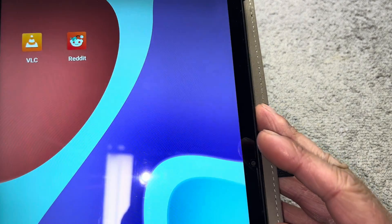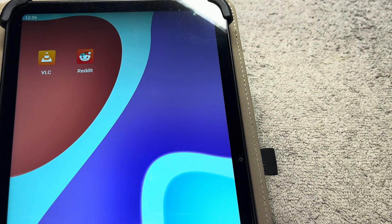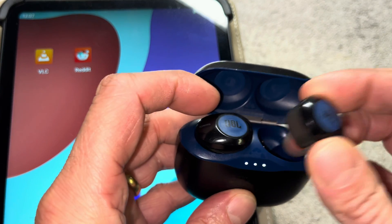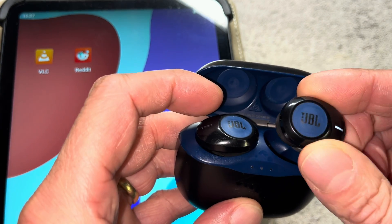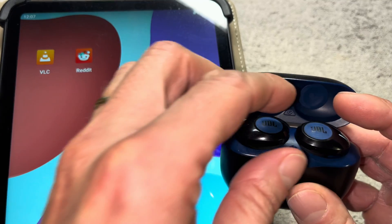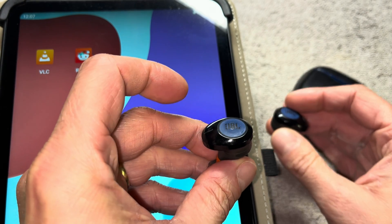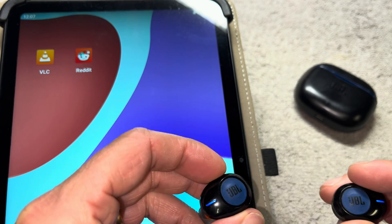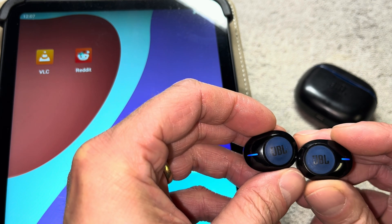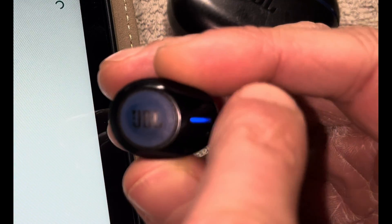We have here our Android tablet — in this case Android 12 — and in this video we want to explain how to pair your wireless Bluetooth earbuds to one of these tablets. The process is really simple and normally should not take more than a minute or two. The first thing we do is take both earbuds out of the charging case. If your earbuds are brand new and have never been paired to any other device before, they will automatically switch into Bluetooth pairing mode, which is usually indicated by a couple of fast blinking LEDs.